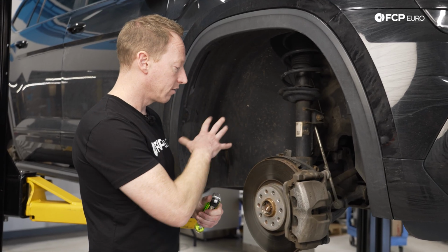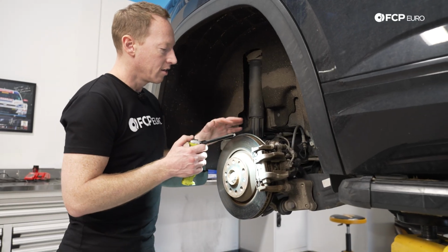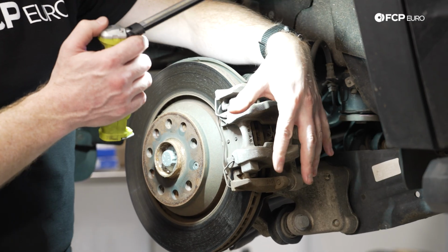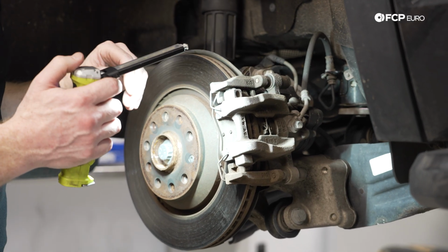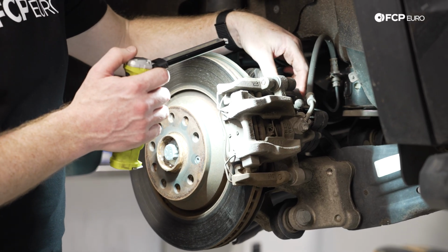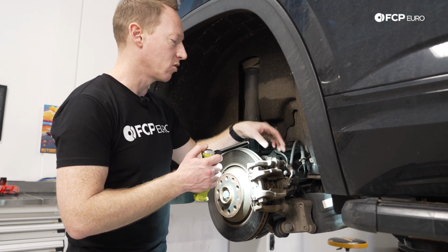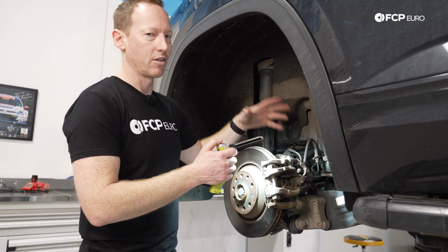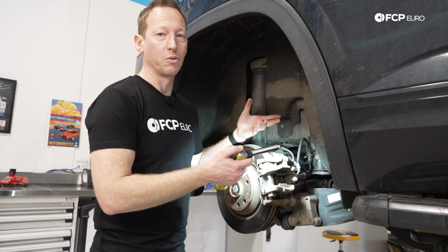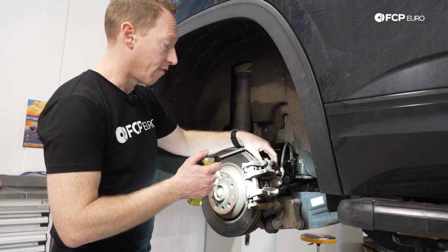We can take a look at the rear, go over some of the same things, but it's pretty much the same story. So here at the rear of the car, we have a look at our brake, and a look at our suspension. Rear caliper here, this is pretty much the same caliper, as I mentioned, that's used on a lot of other Volkswagen and Audi vehicles. Pretty simple setup, sliders. It does have an electronic actuator that can occasionally fail. Typically on these vehicles, especially the more modern ones, many times this will engage automatically, depending on the car, like when you put it in park, things like that. Lack of use is one of the reasons that a lot of the old ones would fail. So modern day, they're not as common, but they do occasionally still fail for sure.